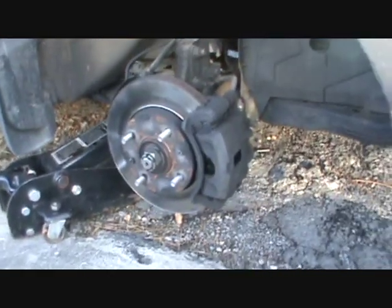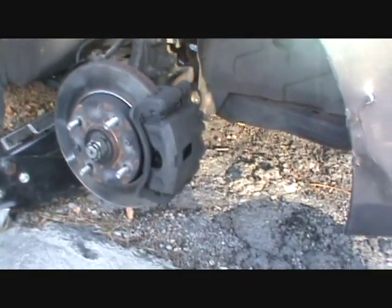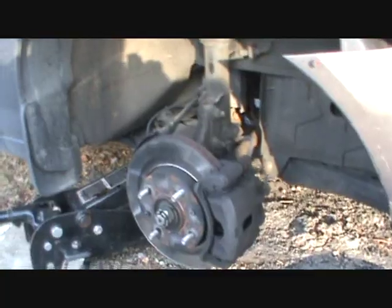Okay, so I got all the brake pads replaced, front left and right. So that's done. It's an easy job on this car. You just have the two caliper bolts. There's one here, and then you got a kitty helper to make sure everything's okay. You again. Look at the grease on you. You can tell you've been under there working. And one down here.